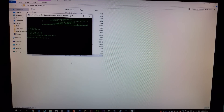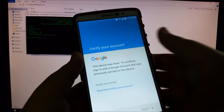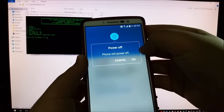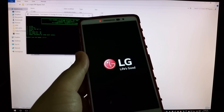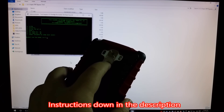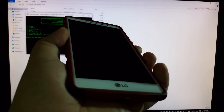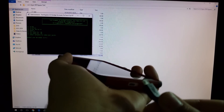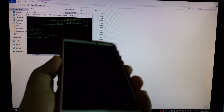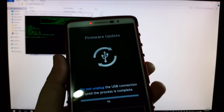The program is now ready. The next step is to get our LG G Stylo into download mode. First, power off the device — press and hold the power button and tap power off, then tap okay. Now that your device is powered off, press and hold the volume up key and plug your device into your computer using a micro USB cable. Hold the volume up key while plugging it in and wait. It will say 'download mode loading' — press the volume up key until you see the firmware update screen.